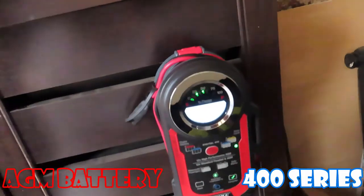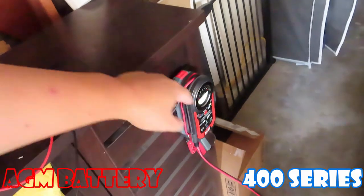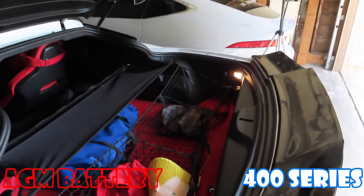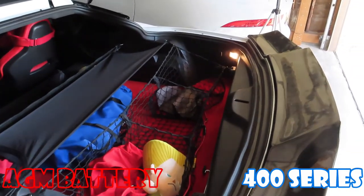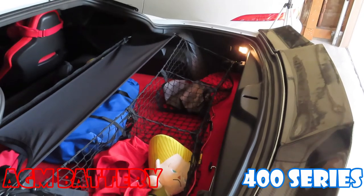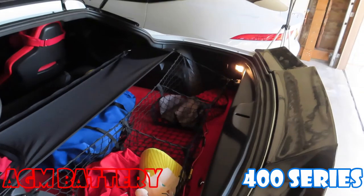So far the battery is good — it's charging. I'm just surprised it dropped to 50%. The old battery that won't start the car was running at 75%, but that one didn't sit for 6 hours — this one did. So with a brand new battery, start the car, and after 6 hours it still has enough charge to start, but it went through about 50% of its capacity. That worries me. This is my review and DIY — trying to fix this battery, the Yellow Top, with two different chargers: the 1200 and 400 series.